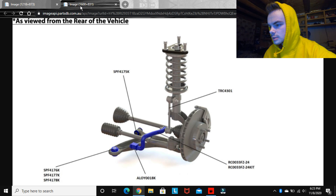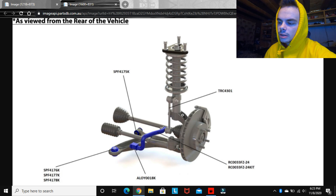And the front — so you have two sensors: one on the strut itself and one down right behind the caliper. You pull that. There's a little 10 millimeter right here that holds the caliper line on. So what we did is we pulled the caliper off and then pulled the axle nut. Once we had the tie rod unhooked and the steering arm unhooked — basically everything unhooked — you just pull the whole thing out. Instead of loosening the knuckle clamp here, which is what everybody does, and unhooking the axle back here, we did it the other way around: pulled the whole assembly out together, then pulled the 13s off the top hat and pulled the whole thing out to swap them.